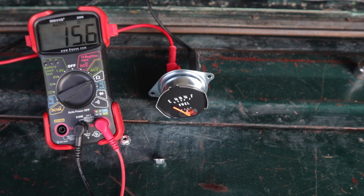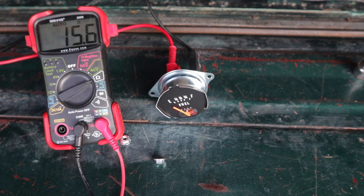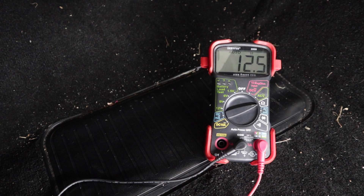If you get between 10 and 18 ohms, chances are your gauge is good. I also checked my gauge under the dash and it's reading 12.5 ohms — lower than the new gauge but still within range, so it's good. If you find that your gauge is the problem, I'll put a link in the description where you can get one from Tom's Off-Road.